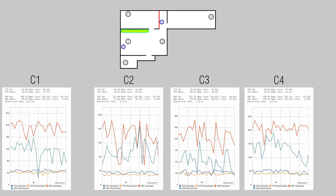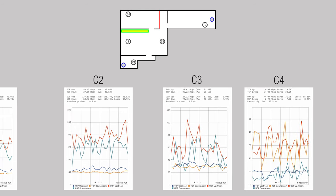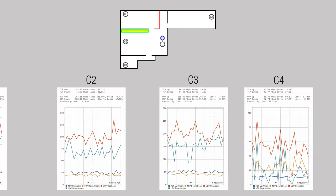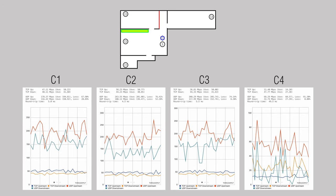While you are looking at the results, I will point out some important features. Inside each module there are two receivers that transfer up to 300 megabits per second with 2.4 GHz Wi-Fi and up to 867 megabits per second with 5 GHz. There's support for MU-MIMO and Beamforming, and you can also enable the 802.11r protocol which allows devices to continuously switch between modules — very important for mesh systems. Worth mentioning that the maximum total data transfer rate in the network is up to 1167 megabits per second.